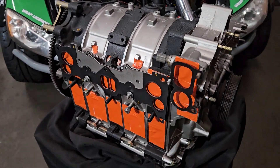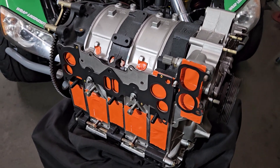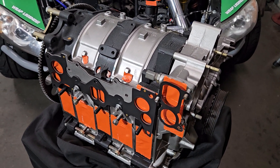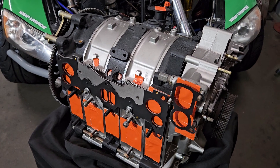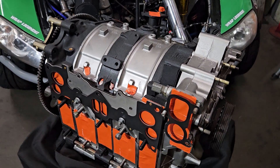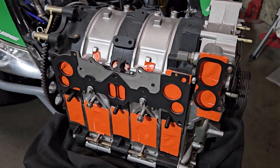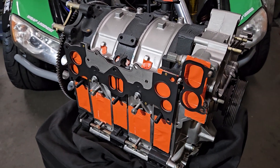I apologize that the exhaust video did not happen. If you're confused as to what I'm talking about, check the links below — you can see the build, dyno sheets, and discussion as to why we built this combination: RX8 six-port Renesis side plates and RX8 rotors modified with GSLSE rotor housings to gain peripheral exhaust, giving us technically six exhaust ports (the center is divided) and six intake ports — potentially one of the highest-flowing 13B blocks you can build.